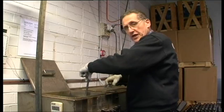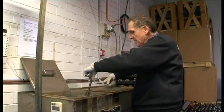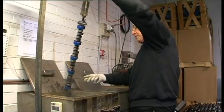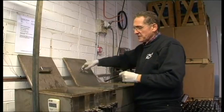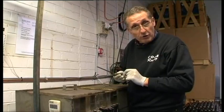I've put the cam in a dual bath. This bath is hot water, just to heat the casting up. This one contains the phosphate. So we take it out of the hot water bath and put it into the phosphate bath. We'll leave it in there for about six or seven minutes, and then we'll come back and I'll show you how it holds the oil.